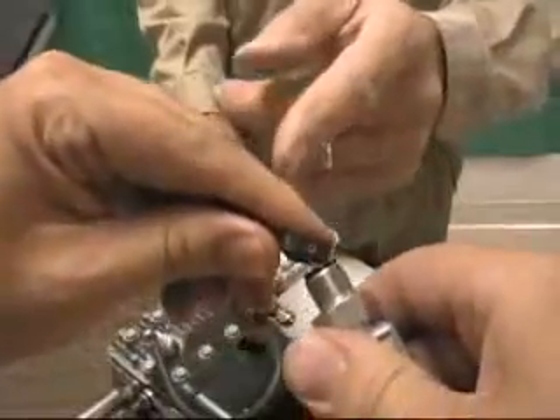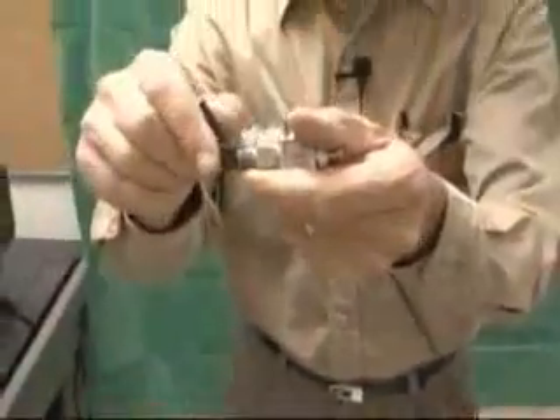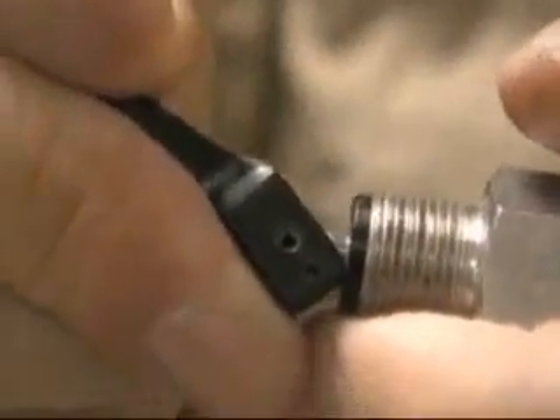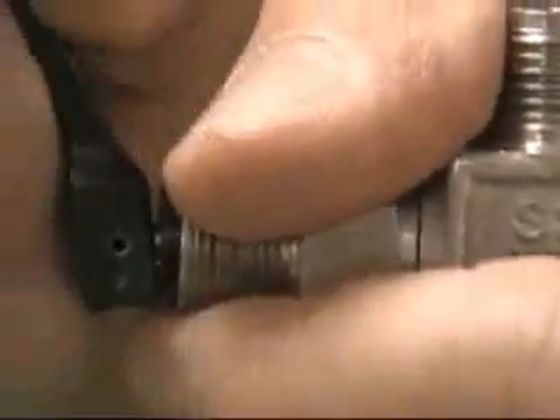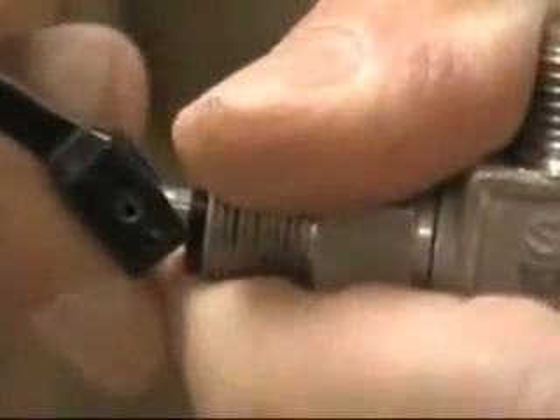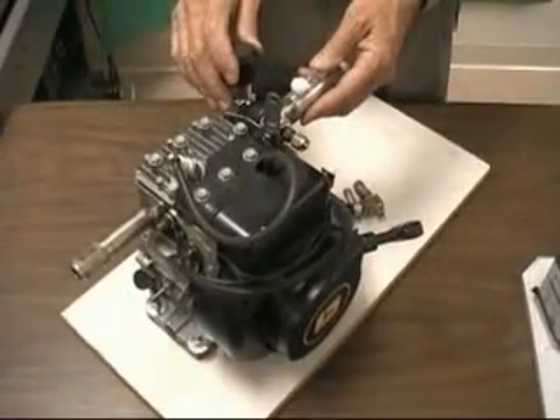The valve moves pretty hard, but you just put it through a cable. This one's equipped with a stop pin — when the pin's in place, you can't take it to full open; it always comes back from almost full open. That makes a handy way to put a lever to your foot feed position, and the foot feed will have mechanical advantage, which turns out to be about the right tension. In any event, you can run it with a single valve or with two valves and still be under $25 in conversion.